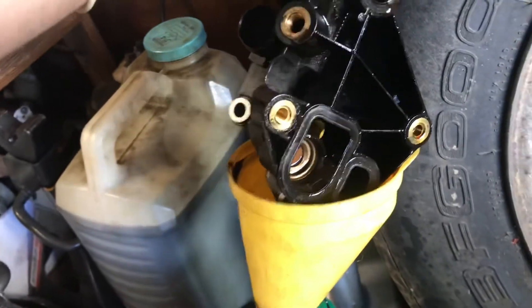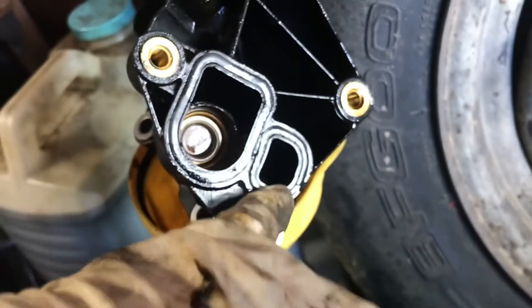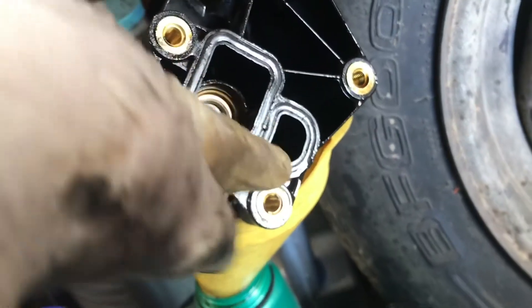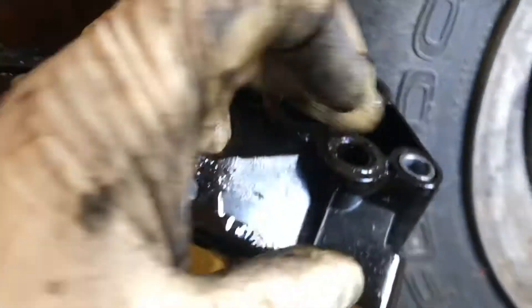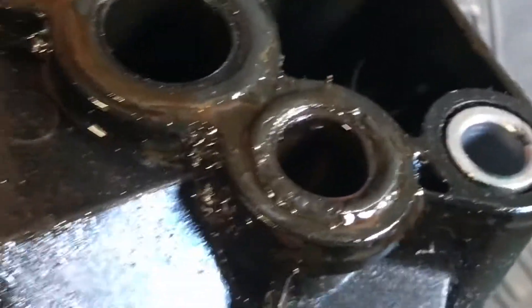Here's one of the failures of the oil cooler on the Volkswagen. What happens is these crack in between here. Ours definitely had a leak — the coolant was leaking on the other side. This is the oil adapter side versus the cooler side. We're hoping the coolant-oil passages were the source. We definitely had an external leak on this side where the white crusty buildup was. It looks like a mouse chewed it, but obviously it's all jagged — very strange.